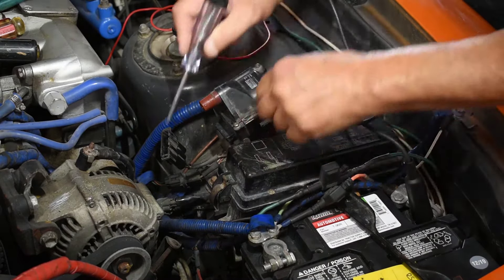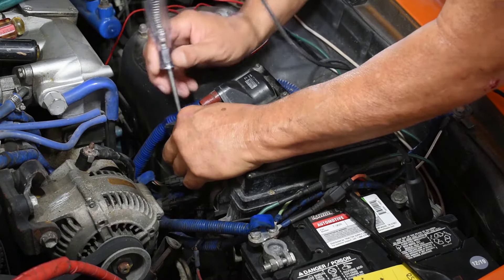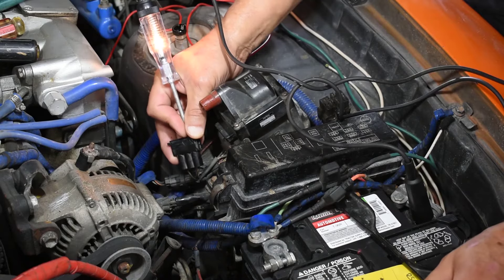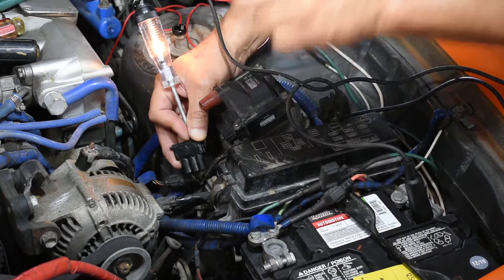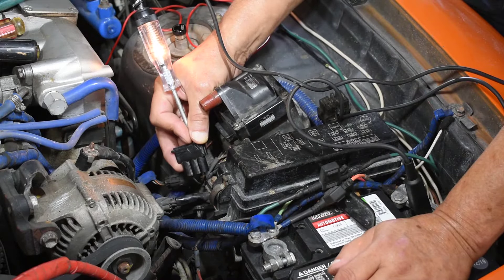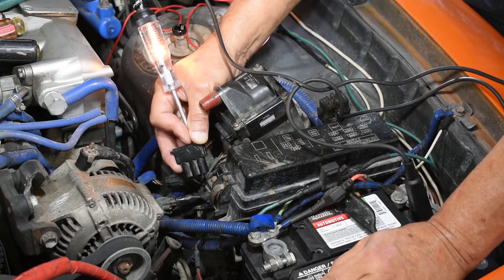I am ready to check for positive. One of these two wires should be hot — hot means positive with the key in the on position. Assistant, can you please turn the key on? The coils need a positive with the key on. But your Chrysler Dodge Jeep vehicles have what is called ASD — automatic shutdown. If you're working on a Chrysler product, and maybe even the Fiat, you have about two seconds to get this test done. Don't get fooled by the ASD.